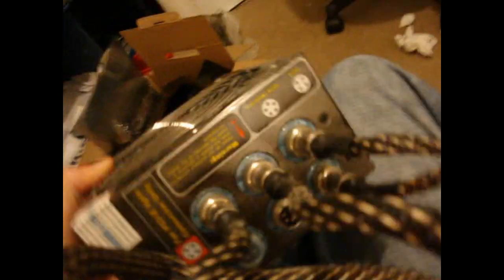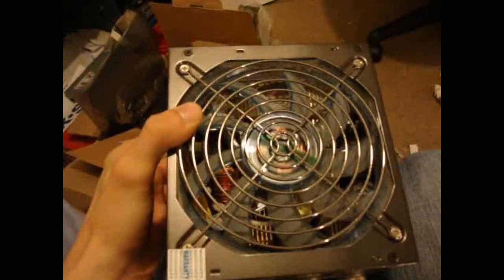Right now I'm going to go ahead and install the two LED fans and get them going. Just to see where I'm going to have all my cables go through, I'm going to insert this modular PSU. I basically have all the cables plugged in that I'm going to need, leaving only two free. It's an 800 watt modular power supply. I'm going to insert this and figure out where I'm going to have everything plugged in, then start doing cable management. From there I'll probably insert my other fan, then hard drives, then video card, then sound card, and go from there.